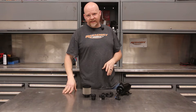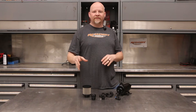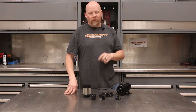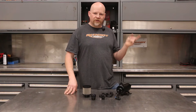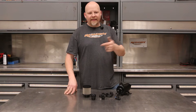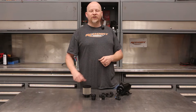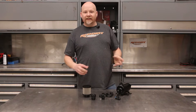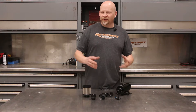The clean side of the PCV system is on the top of the valve covers. There's no valve there — it's just a baffled hole — and those two hoses run to the air intake tube to ensure that it's metered air and flows into the engine. That part of the system works in two ways: the clean side goes from vacuum to pressure under different conditions.